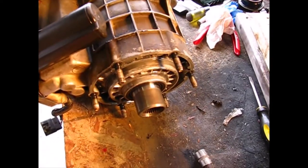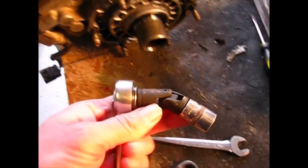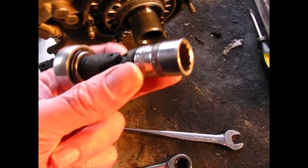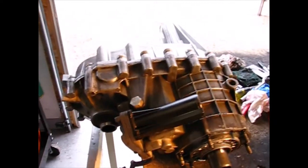There's one way up on top — the very top bolt — that's pretty hard to get out, so I used a 3/8 ratchet with a 3/8 universal 15mm socket. Got it off there, no problem. Out comes the transfer case. That whole process is pretty simple, probably take you a couple hours.